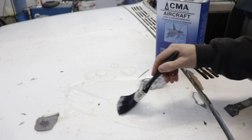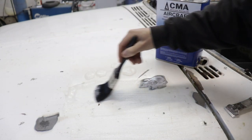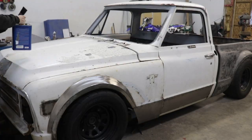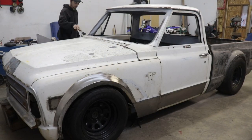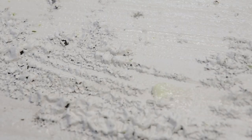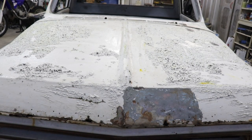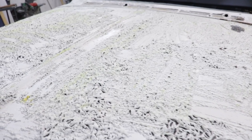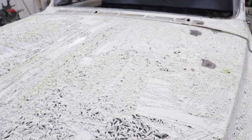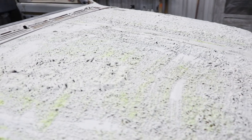I'm not sure how this stuff is going to work. I'm just applying it with a brush, not going to put too much since I have to do the whole truck, but I'm hoping it'll work pretty good. That paint remover seems to work pretty well — you can see it's pretty much all crinkled up and that's going to come off pretty easy with the razor blade. It saves me a lot of sanding, and we'll see what's underneath all that old paint.